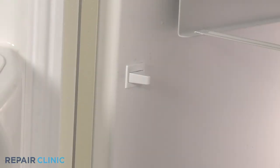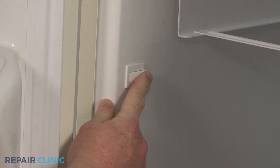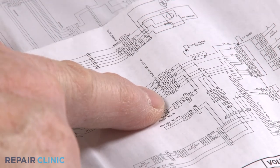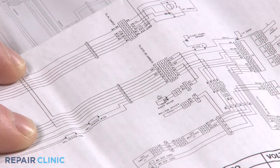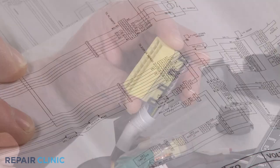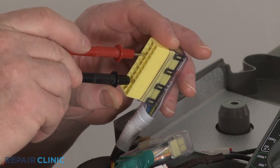Be aware, you may need to actuate a door switch or hinge cover switch to allow power to reach the dispenser connector plug. Referring to the appliance's wiring diagram, identify the incoming power wires to the dispenser. The wires may be identified by color or number. Contact the black meter lead to the ground or neutral wire terminal and the red lead to the power wire